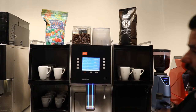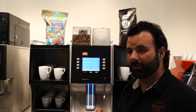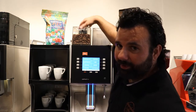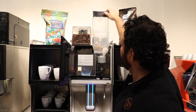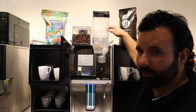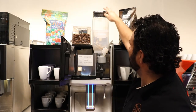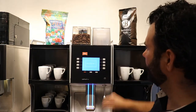This machine is a two bean machine and it also includes powdered chocolate and milk, so I'll go through how to fill those hoppers. That's hopper number one for regular. The decaf hopper is in the back — you pull the top and fill it that way. For your powder and chocolate, you open the door, cock that back, and you can fill it this way. Or you can pull this entire unit out, fill it, and then place it back in the machine so you don't spill powder and chocolate everywhere. Close it and close your front.